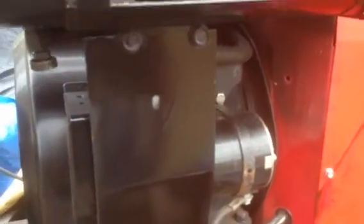Basically what the schematics show is that this generator has no exciter to excite the main field windings. Instead, there's supposed to be a charging coil behind the flywheel of this engine — actually I think it's just a small alternator stator coil that goes behind the flywheel, using permanent magnets on the back of the flywheel.